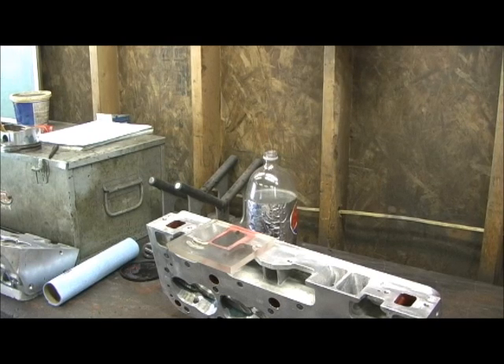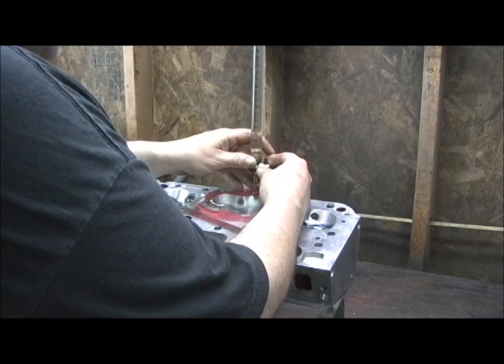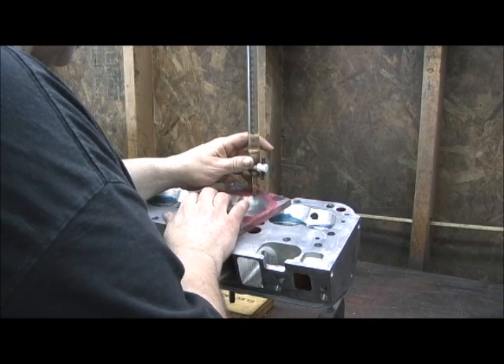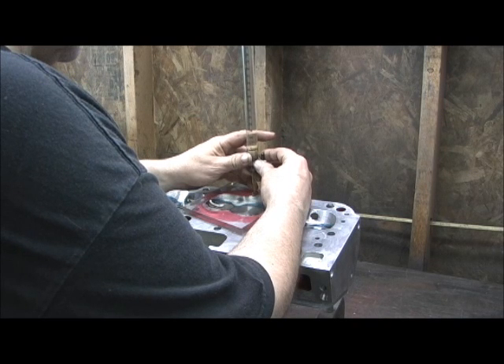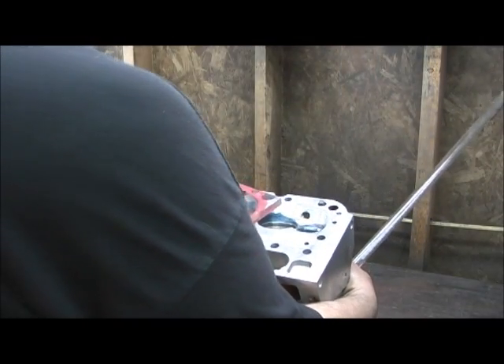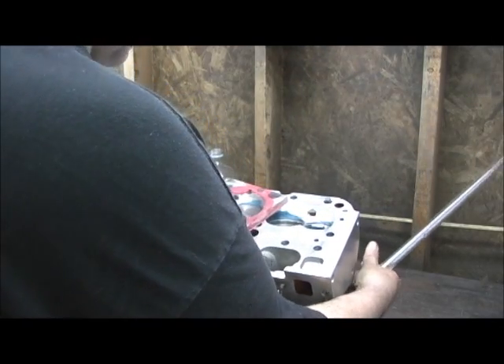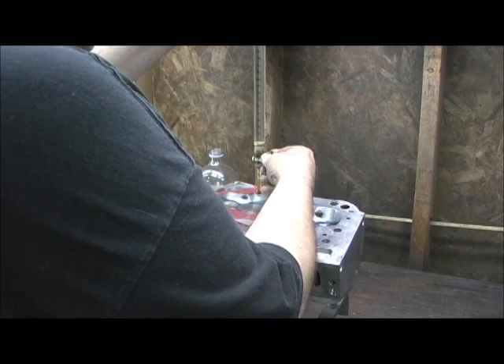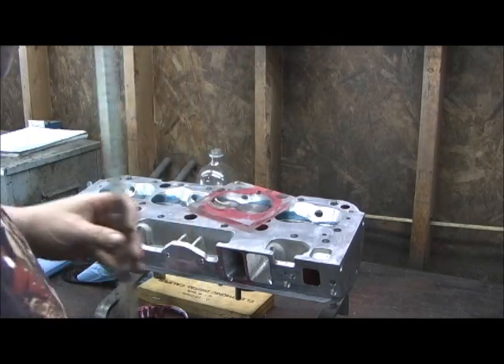So I'm going to stop for a second and go ahead and set it up. What we're going to do now is we're going to hit the combustion chamber side — we'll be interested to see what this is. Like I said, I know I cut the meat out of it and had to move that spark plug back, so hopefully it ain't too big. Once again, chasing them damn bubbles — I've had to turn heads all the way upside down. 71 CCs, right on the money. That's on the combustion chamber.